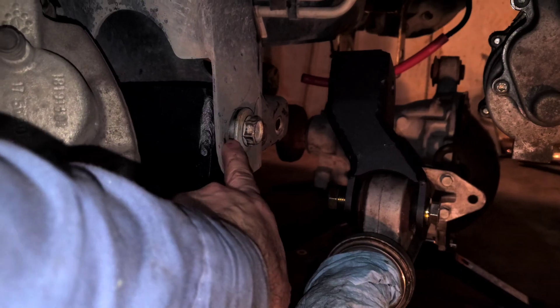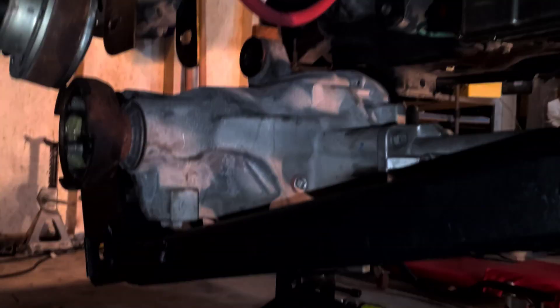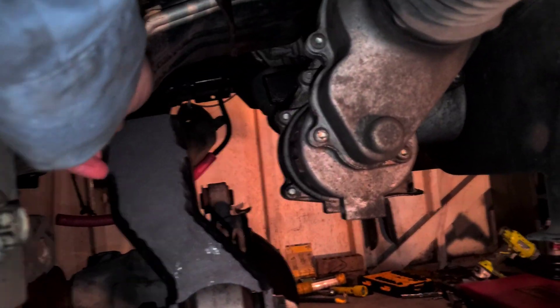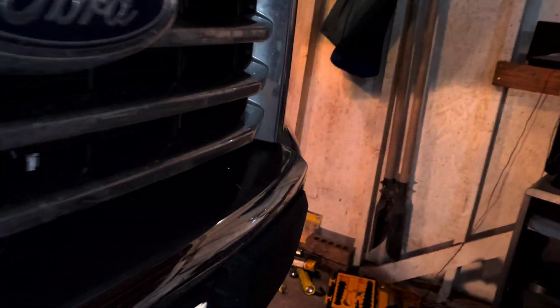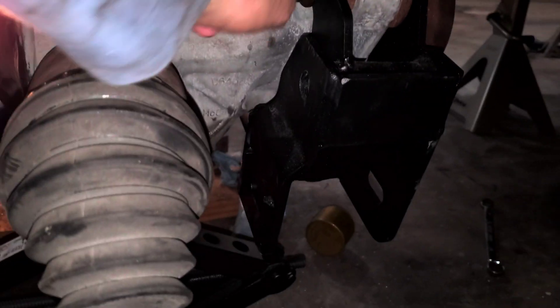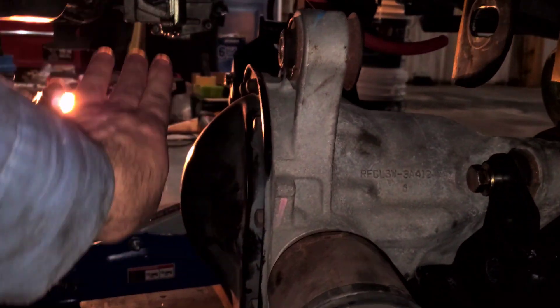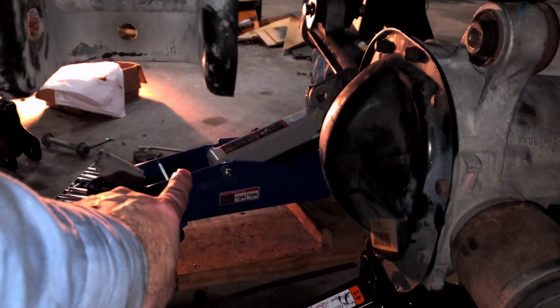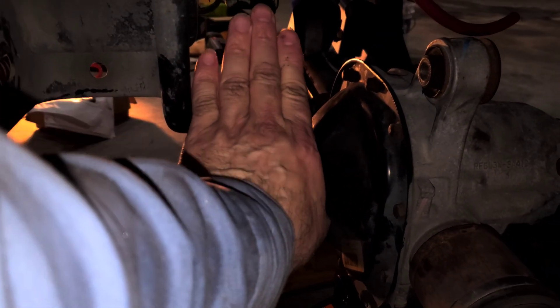What I decided to do was put this cross member in — I already did the cutting over there. I put this side of the cross member in and got the nut on the other side. I had the differential on the ground and put it up there. I also put this bracket on — it's ready to go in that hole. I almost got it up there and I stuck this one bolt in and had to lift that end up to get the differential parallel with the cross member. The jack is there just to lift that side up.